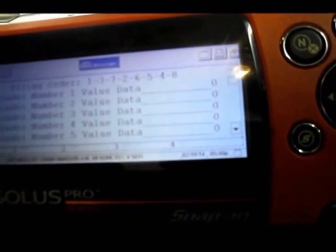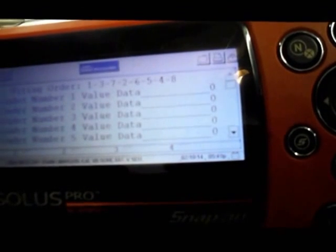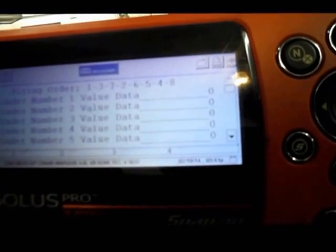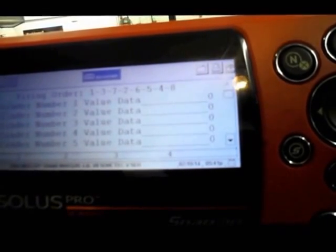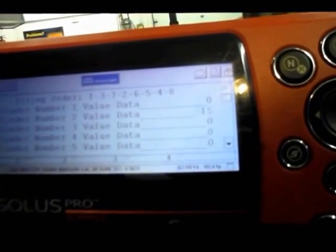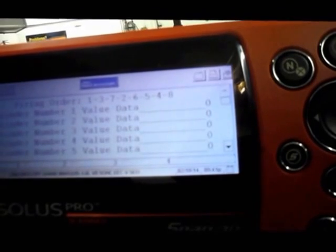That's the contribution to the misfire in number 2 cylinder. So most likely we have a problem with the coils in this car too, or the manifold gasket itself is just leaking so bad that it is causing a misfire.